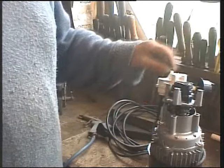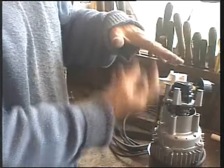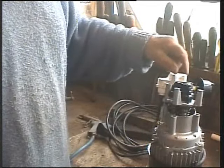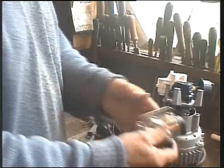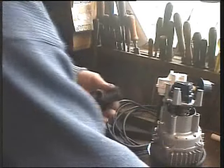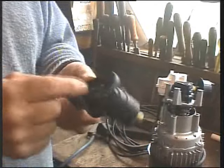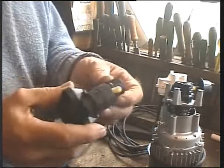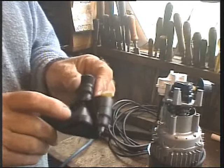These leak — the three seals, a swash plate, and three plungers come up and produce pressure. They get microscopic cracks in them, as does the top piece which sits on top. And if you knock that out, that plastic piece also goes. Now you can look at it as hard as you like and inspect it and see nothing wrong, but it isn't until under pressure that those minute cracks open up.